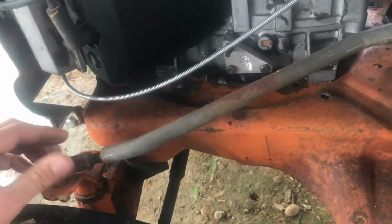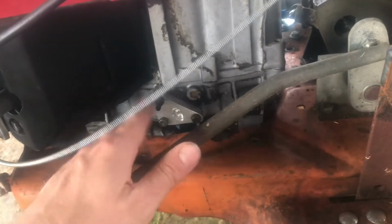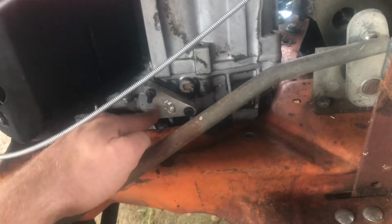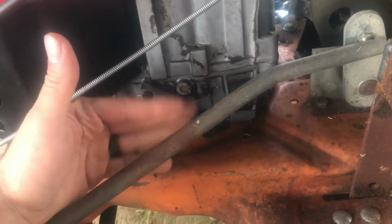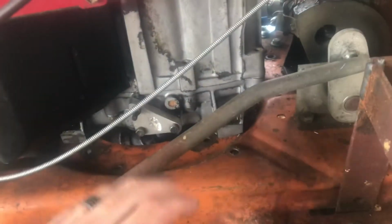The joints are pretty tight, but it pushes the axle back and forth a lot, so it's pretty loose. I wanted to figure out something different for that, because I don't like loose steering. I'm used to Wheel Horse stuff. If you see here, I did the oil filter delete, because the oil filter would have been right in the way of the steering arm.